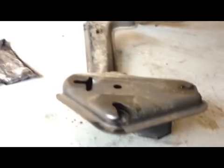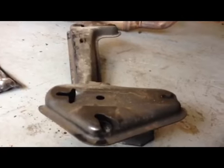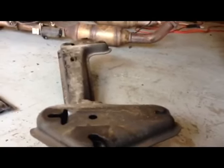After that, I took off the transmission mount. It holds, actually, as a matter of fact, not even the transmission. It holds the transfer case, it mounts the transfer case. There is a long bolt in between this one. After you open three bolts on each side, these are the bolts that you're opening on each side, you push the bolt out and it will give you the transfer case exposed.